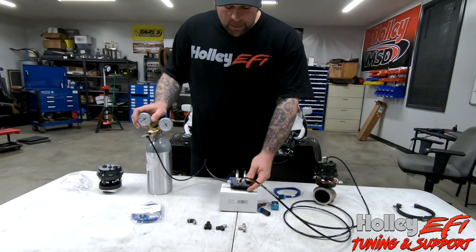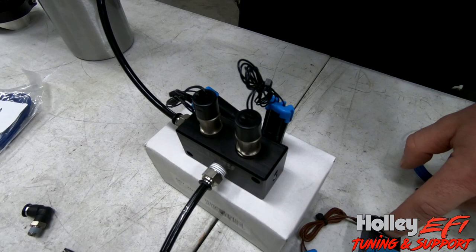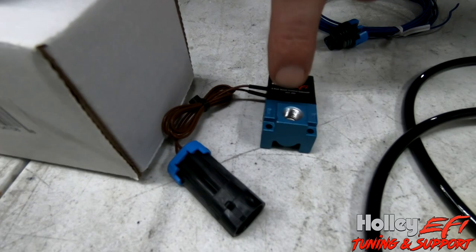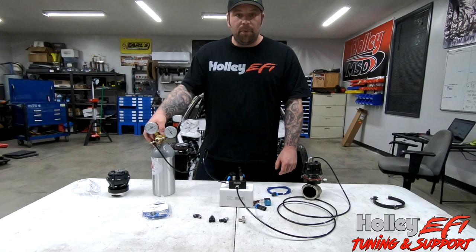The reason why a lot of people have been switching over to these new solenoids is they respond a lot faster. These are actually bullet-style MAC valves, and the old school MAC valves have a little bit slower response time. We're always in the quest of trying to find every last hundredth of a second, and these have come in handy when it comes to trying to get boost following dome pressure.